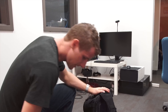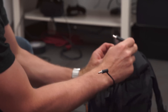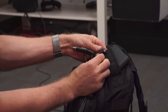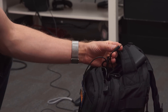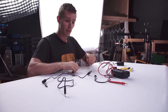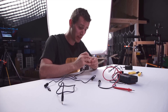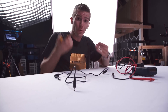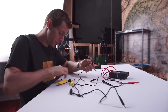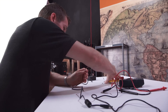The last thing we need is power. I could have grabbed an extra power adapter — they all use the same 12-volt power and the same size connector for the cable breakout box and for the headset itself. But even if I did bring one from home, it wouldn't be right-angle, and I really don't want to destroy that cable. So I hit a bit of a roadblock. While I was able to strip down the HDMI cable and the USB cable to make the cover fit on the Vive headset — which is more important than I thought, because the head strap doesn't go into place without it — I don't have a DC power plug. The only one that comes with the Vive that's a reasonable length and isn't attached to the tether is straight, and already needed for the breakout box.